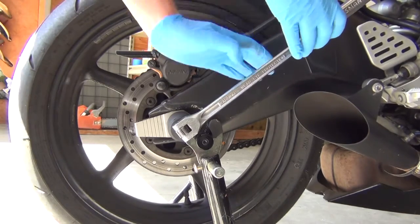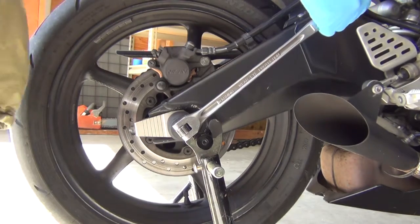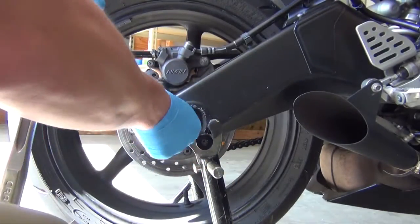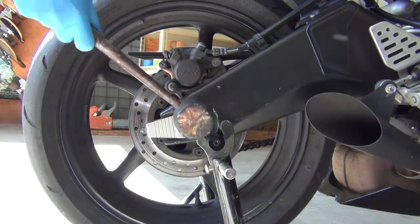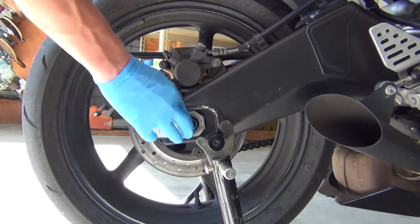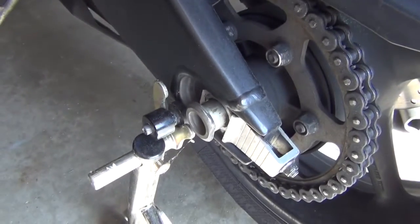I know you can't see it, but I'm gonna put my left hand on top of the bike to stabilize it. So if this nut is really locked in place, I'm not gonna lift the bike up off the rear stand. Boom, just like that. Next, you wanna take a soft mallet, like so, and just gently bump this axle through the bike. Lost a washer. Keep track of everything. And from here, you can see my axle's already sticking out on the other side.